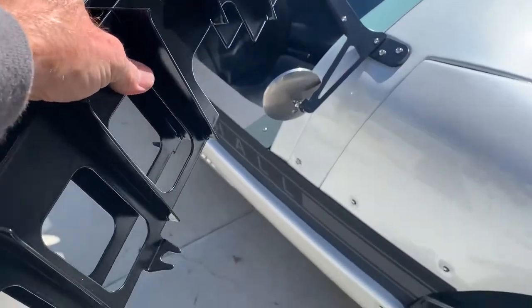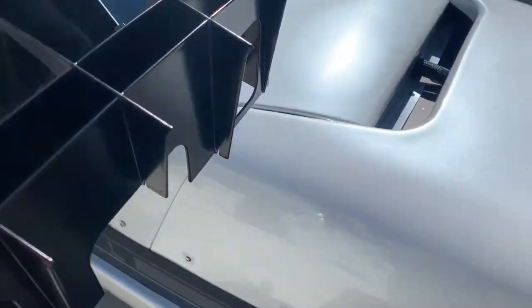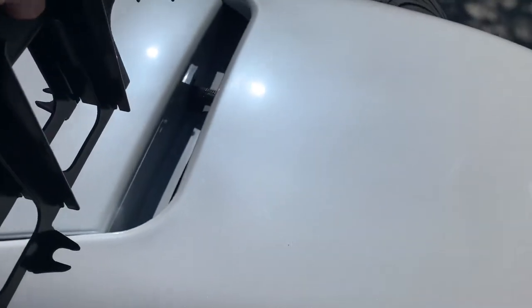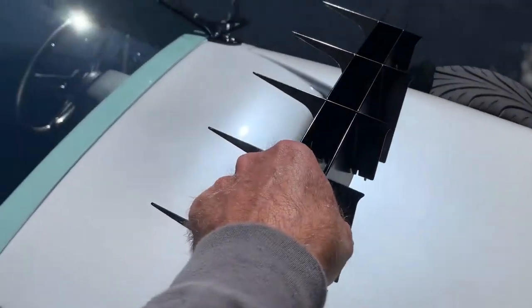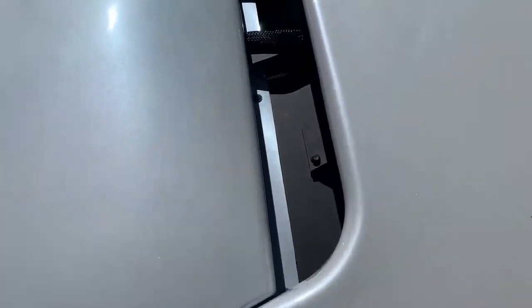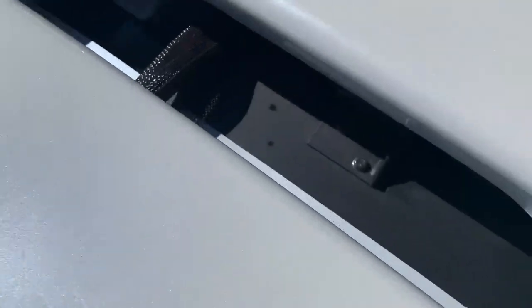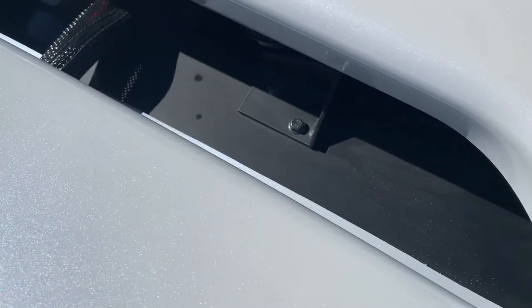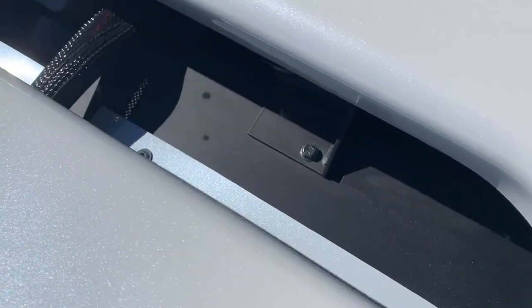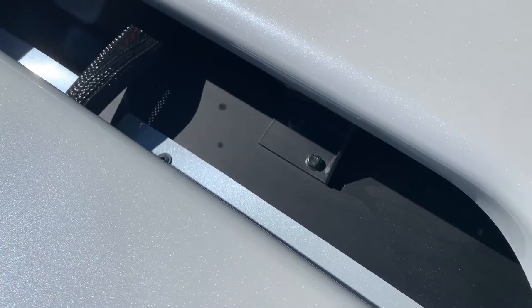This is the cowl grill and it will fit into the opening between the main cowl and the secondary cowl near the windshield. There are three screws that we're going to loosen up, and there's also the air filter bracket. We'll loosen that bracket up and one of the tabs will slide underneath it — that's really the simplicity of it.